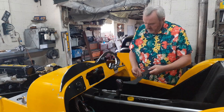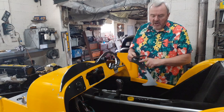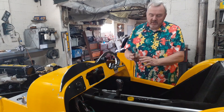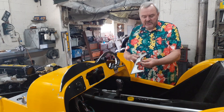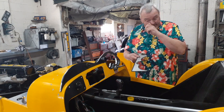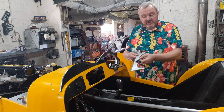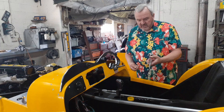This one's just got the indicator switch in it. You can see how they're all made — it's just flat aluminium pieces with some carbon fibre self-adhesive wrap. When you try and tuck it over the edges, get yourself a hot air gun or a paint stripper gun and warm it before you pull it over. That softens the plastic and allows all these corners to be moulded into shape with your thumb. If you don't do that, it'll be on there for half a day and then start to peel back up, because the plastic is trying to return to its original shape. So use a hot air gun, warm it, and then push it over.